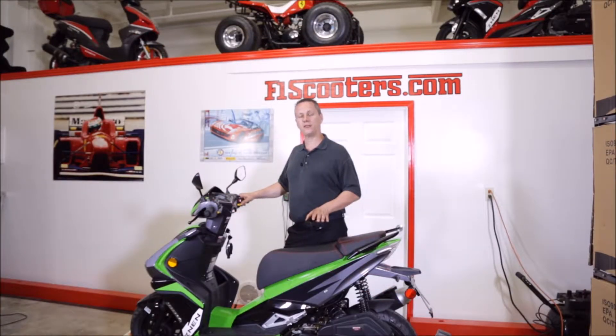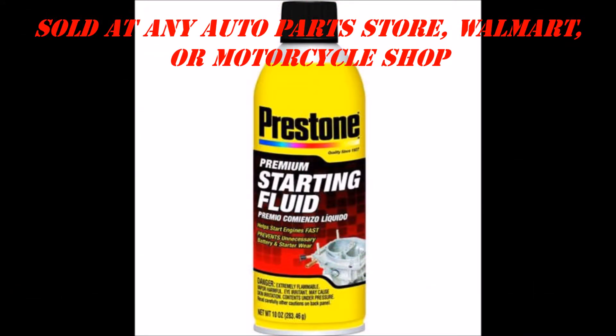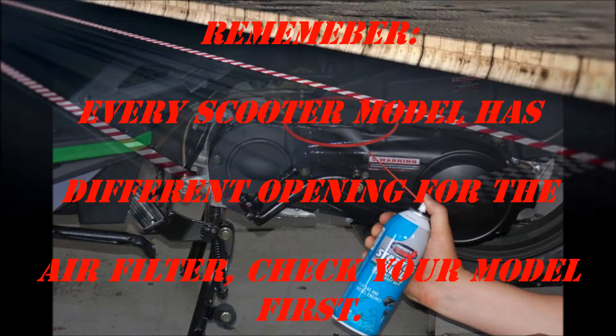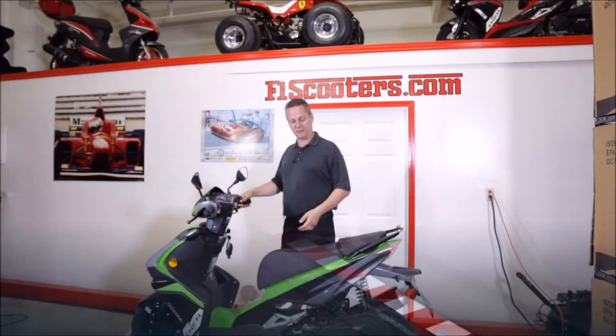So when you have a little difficulty starting it, we have starting fluid here. You can just shoot that right up into the nostril, wherever the air intake is for the vehicle. It might chug a little bit — sometimes they do. This started up a lot easier, but when you put a little bit of that up in there, it'll start up pretty fast. That's kind of a way of cheating.